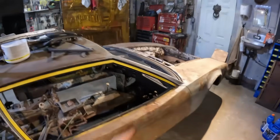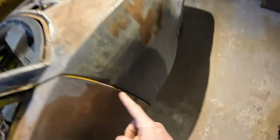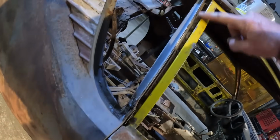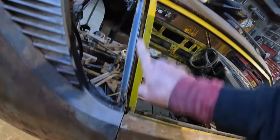It's actually bendable. But on this side, check it out. As soon as we were leaning on that side, boom, this door closes perfect now. It's even got a pretty good gap. It's really good here on the front end, but you can see on the back edge, this isn't parallel here. So I'm not 100% sure. This is pretty tight. It's actually usable. I can deal with this, but you see it's rotten here, right? It's almost like I need to hit this thing back somehow. But I'll take a look at some pictures of other Panteras and check out this door gap just to make sure it is parallel. And I got a really good gap all the way across here.